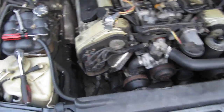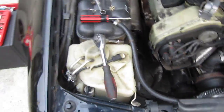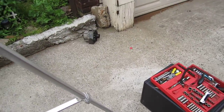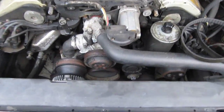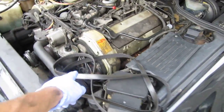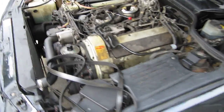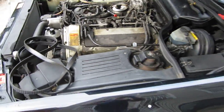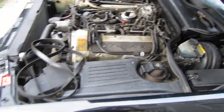The engine is a little rusty. The alternator is dead — there was a short on the alternator winding, so I'm going to have it rebuilt. The belt is messed up, the belt tensioner is messed up. The distributor rotor and caps are bad because the wrong spark plugs were used — resistor spark plugs were installed but non-resistor plugs are required.